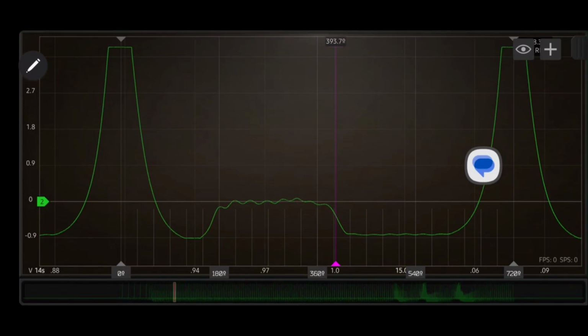Anything that moves left on the scope screen is advanced, and that's with any waveform. So this intake valve is actually retarded. Now we want this to be 30 to 60 degrees after this bottom dead center line right here, which is where we want to see this intake valve close and start to rise. You can see that we're just past the 60 degree line is when our valve is shutting and starting to rise for our compression for our next fire stroke.